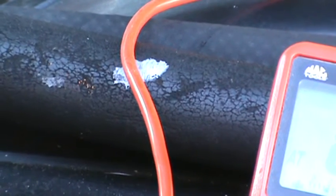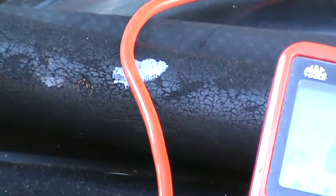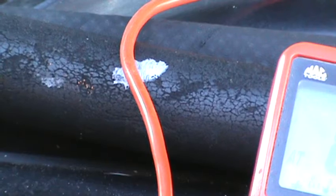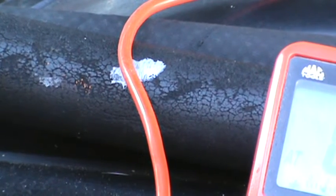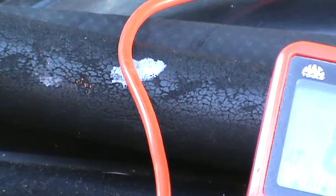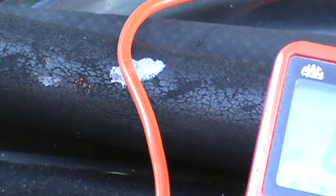Make sure you don't have any misfiring spark plug wires or anything like that, because if you have a spark, it's going to ignite, and you're going to scare the crap out of yourself. But you can do that, and if you notice an increase in acceleration or a decrease in acceleration, then you have a vacuum leak.